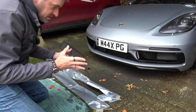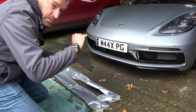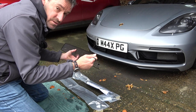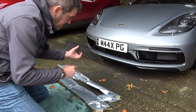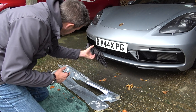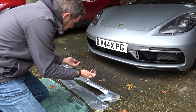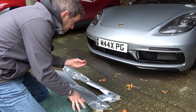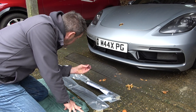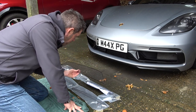As I said, the front of this car's PPF'd. They recommend that especially with these little clips you just put some masking tape on the bodywork, which I'm going to do. Then you just use a flat-headed screwdriver to push the clip - you put the clip in one side, which is relatively straightforward apparently, then you just bend the trim slightly and clip it in. Let's give that a go - we'll fit this one first because it looks like it's the most pliable and maybe the easier one.